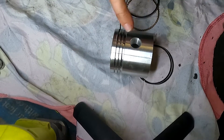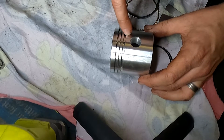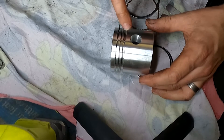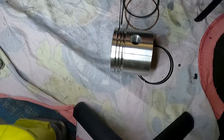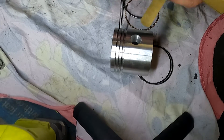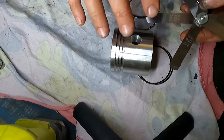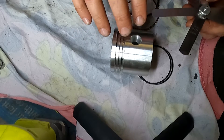Once you've checked one, go and check the other ones. Now between the oil control ring and the piston it's going to be between 0.0015 of an inch and 0.0035 of an inch — so significantly smaller tolerances. You need to make sure that when you buy a set of feeler gauges it covers not only imperial but also the lowest amounts possible, depending on the application you're using it on.